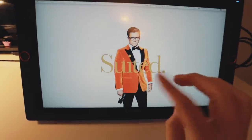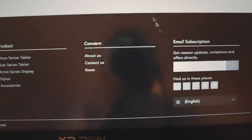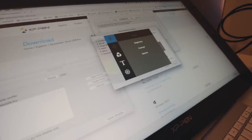The colors are slightly different, but I haven't calibrated it yet. I have to install the drivers first. I'm on the XP-Pen website with the Artist 22R Pro and I'm downloading the Mac version. Hopefully I don't have to reinstall my Wacom driver either. It's already set itself up as a secondary monitor. Here is where you can adjust the color profiles of the monitor — it's in the Display options in System Preferences if you're on a Mac. I'm going to calibrate it myself. Up here are some settings to tweak like the brightness. I keep accidentally hitting the power button when changing the settings, but luckily you don't have to do this often, just when you first set it up.